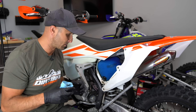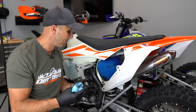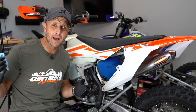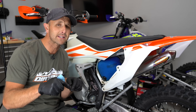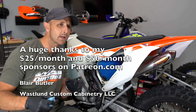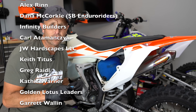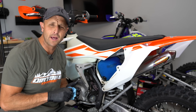That's pretty much it. I'm going to finish the Sherco as well. Make sure you've got plenty of oil on the filter, good coverage, a little grease around the skirt, and always have another one on hand ready to throw in when the current one gets dirty. If you've got questions, leave your comments down below. If you want to help out Dirt Bike Channel, go to dirtbikechannel.com/parts to order through those links — the channel gets a small referral bonus. Thanks for watching and I hope you get out and go ride.